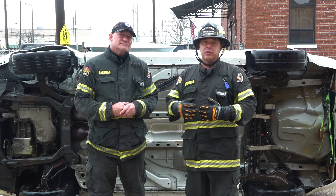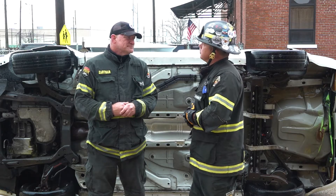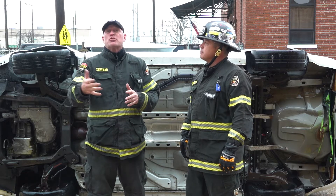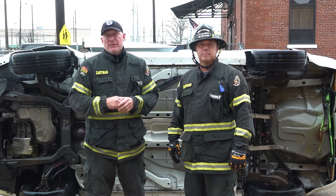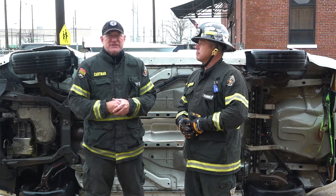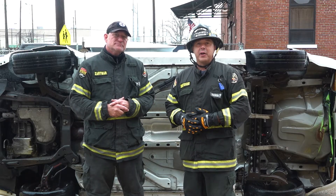While technically this can pose some challenges, the end result is to get the vehicle on its side safely, present cooling operations, and fill the bucket. Remember to stay true to your primary mission and don't over-rescue or over-complicate. Today's demonstration illustrated a very controlled technical rescue reorientation with the strut providing resistance and a full tension buttress, but in a real world scenario with no victims in the vehicle, transitioning the vehicle all the way into an inverted position is not problematic. You still have access to your penetrating hole or vent point and can aggressively cool the battery pack. Thank you for watching Fire Engineering Training Minutes.